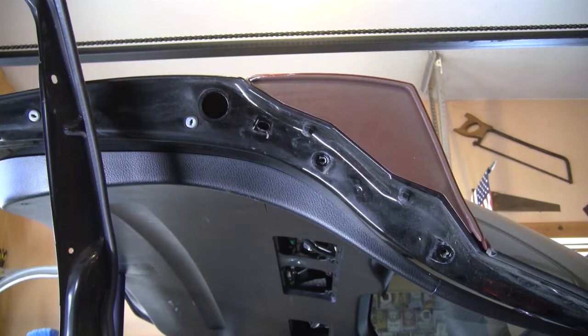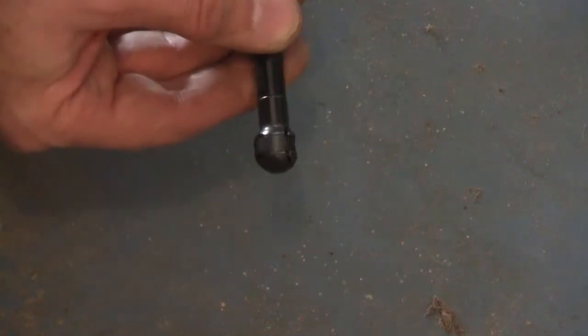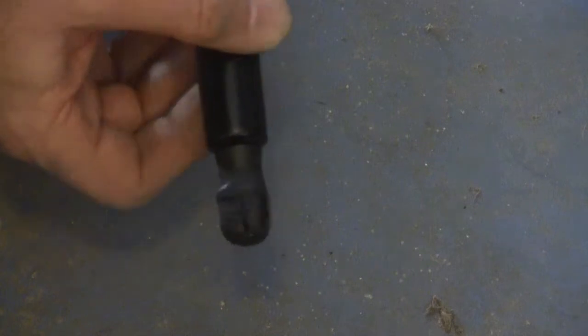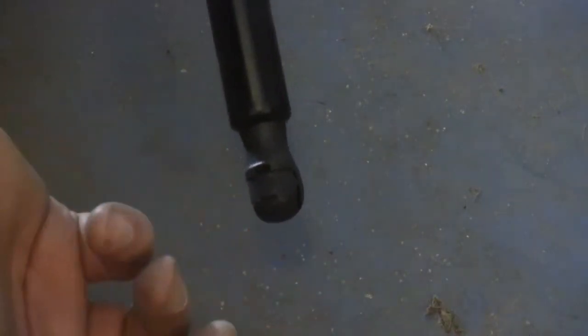Now let's look at reusing the bracketry — there's going to be a little work involved. This is our replacement piece, and inside there's a little spring. All you do is work a small screwdriver underneath the back side — it's a strap spring — and it'll lift and separate the pieces apart. You push it onto the ball and push the spring in, and you're locked on. It does that at both ends. You just pull it out a little bit — you don't need to pull it all the way off. If you do, it's a little hard to get back on. Trust me, I know that.